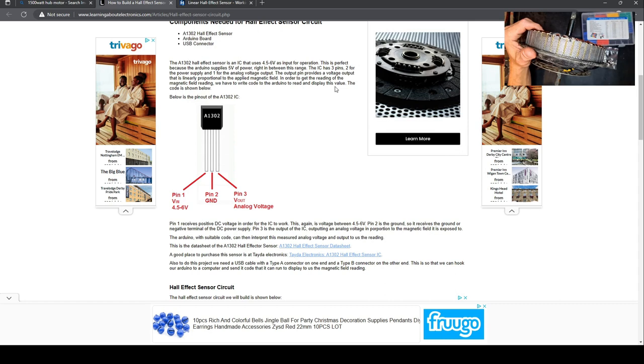Quick note, there are two types of sensors fitted to most e-bikes and scooters. One is called a bipolar or a switching sensor. That works how I just explained. Every time it passes a plus or minus magnet, it turns itself on and off. The other one is called a linear hall sensor, which is commonly found in throttles. That detects the magnetic field in relation to the distance to the sensor. Basically, as you apply pressure to the throttle, the magnet gets closer to the sensor, which slowly increases the voltage back through that sensor line.